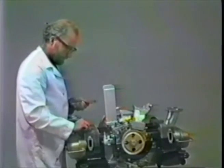You can torque them, or you can just use a calibrated arm, but don't overdo it. This is an aluminum head. And aluminum heads don't like to have spark plugs that are over torqued. So you can do all these at once if you want to, or you can do one at a time. Take off the little cap. Don't ask me why they put these things on in the first place, when most of the plugs they sell, the little cap comes off. Nowadays, like I say, the cap is separate, loose in the box. Take it all off.